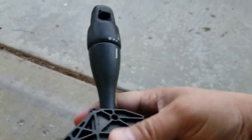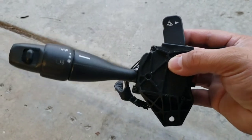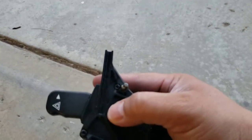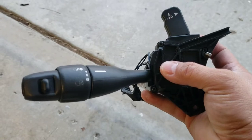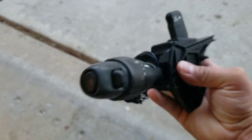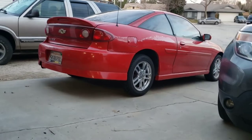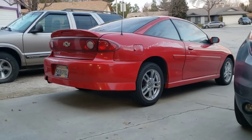But what I did is I switched out the old turn signal and headlight switch. It wasn't too hard to do. It is involved because I learned today, you need to disconnect the battery for any kind of work you do. This kept touching like brass and it kept honking, and after a little while it started getting annoying. But this side is very important because this turn signal switch also has, you can't see it, but it also has the cruise control on it. Well, I mean, you can see it right there. So I swapped that out. The headlights turn back on, but it hasn't been cold enough for me to check and see, so I'm gonna do it tomorrow morning. And I'm gonna check also on Monday.